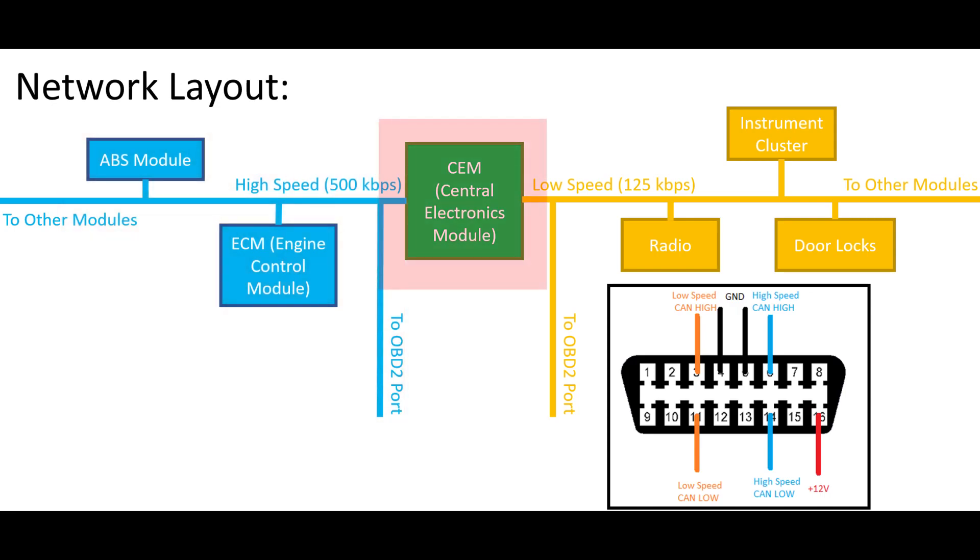The CEM, or Central Electronics Module, located above the passenger side kick panel, acts as a gateway between the two networks, allowing some relevant traffic to traverse the high-to-low-speed barrier, similar to how your internet router works as a gateway between your local home network and the internet. Unlike some cars, the CEM in my Volvo does not also act as a gateway to the OBD2 port. This means that all of the traffic sent on the CAN bus is available to work with. Additionally, Volvo went the extra mile and also pinned out the low-speed bus on the OBD connector, allowing access to both the high- and low-speed CAN bus segments with completely unfiltered data and no wiring harness splices required.